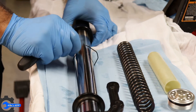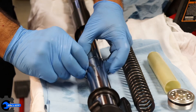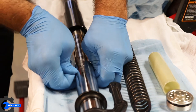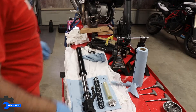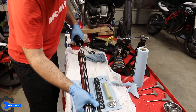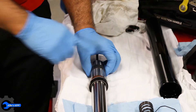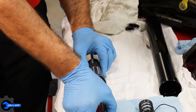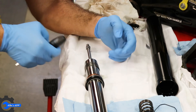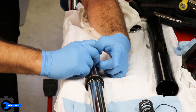So we have the dust cap, the ring, and next to go is the actual oil seal itself. Let's remove the ring taking care that the ring does not scratch the fork, and now with not so gentle movement, we're gonna remove the seal itself. First thing to remove is this retainer ring over here — use a little bigger screwdriver — once you have it, you don't want to scratch the fork so you pry it apart a little bit.